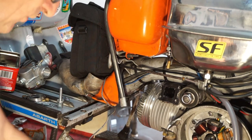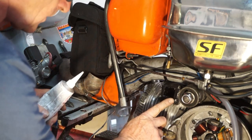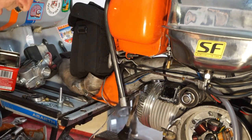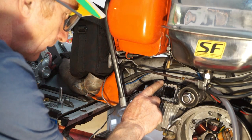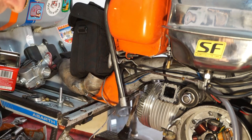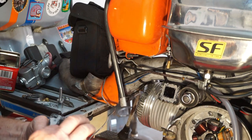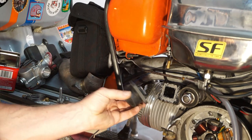Right, let's get our new manifold on. Hopefully it's good. So we're going to go for some 3-bond on here. To be sure, the tube seems to be a little blocked, but and a little smear on the back of the manifold as well. We do not want this to leak, and we're going to do a pressure test on it. We'll give it about 10 or 15 minutes for the 3-bond to cure a bit, and we should be able to test it. So that goes on with our sealant